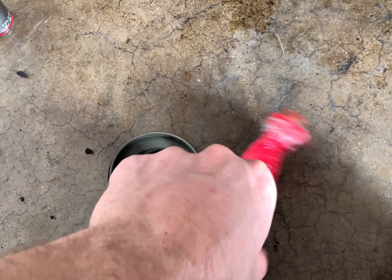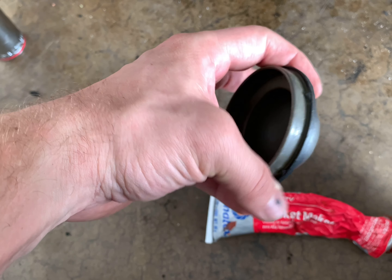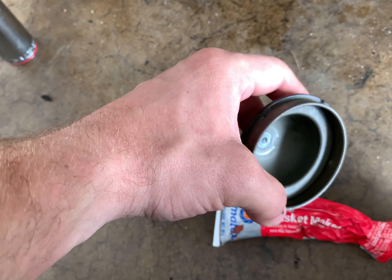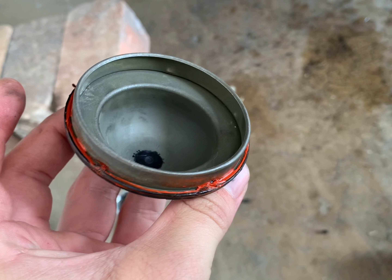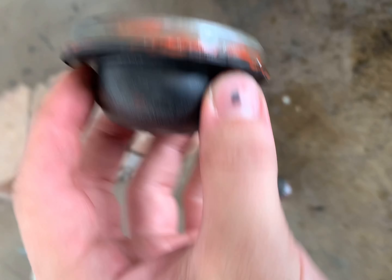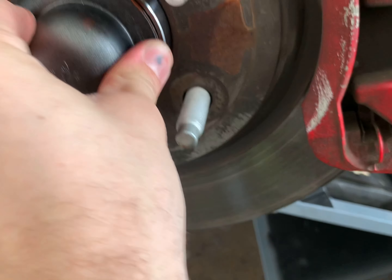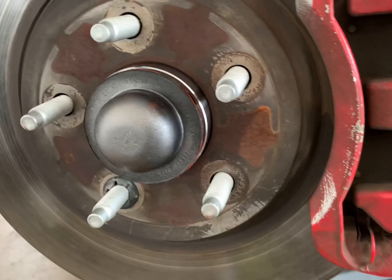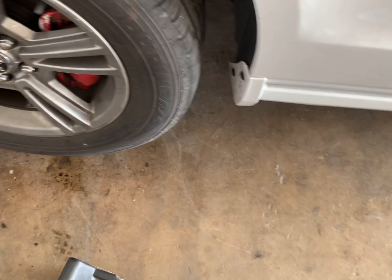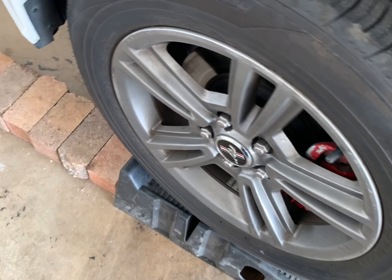For the center cap, I did bang it a little too hard so I just want to make sure no moisture gets into it. I'm gonna be putting some gasket maker just around the little spots where I hit it — just a little bit on each spot — and then I'm gonna be banging this back in with a rubber mallet. Final step is just to put the wheel back on, put the bolts back in, and slide the ramps underneath it. We're good to go.